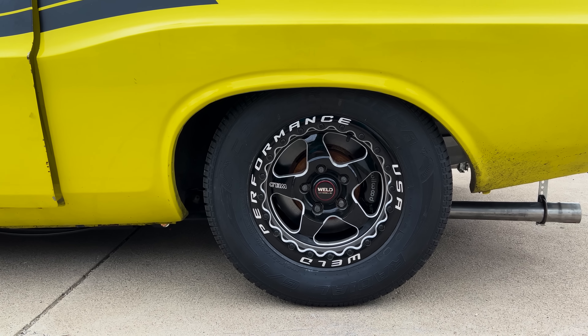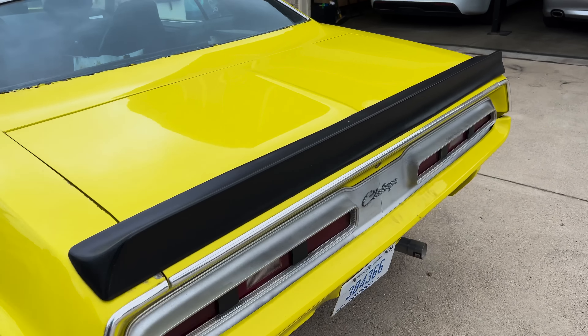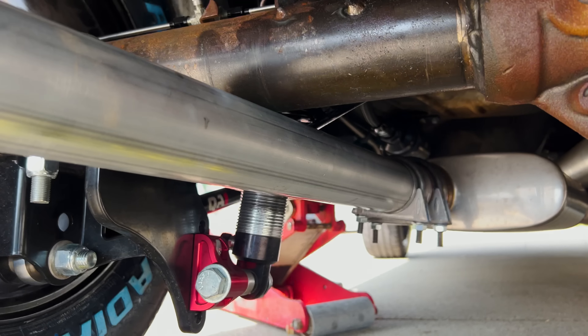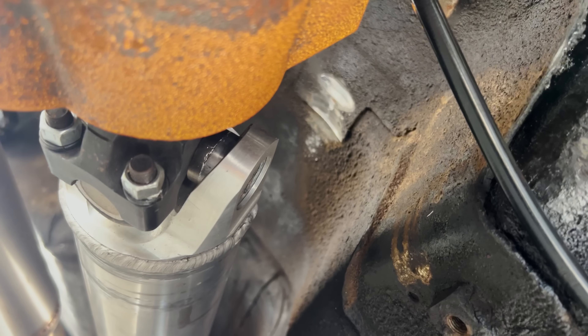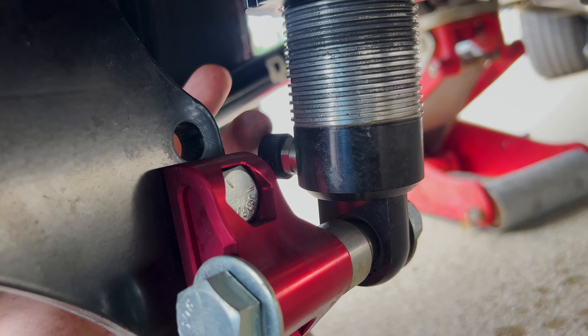So we now have to raise the car — it actually looks like it's sitting way too low. We have a lot of stuff in the car too, but it looks way lower than it was. So we're going to bring the whole car up an inch. We lifted up the shocks — thankfully the QA1s make it really easy. You can see the wear and tear there — it's hitting the stock body. Our fat asses weighed it down.